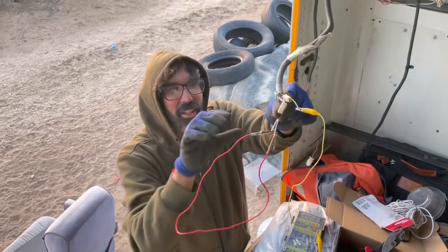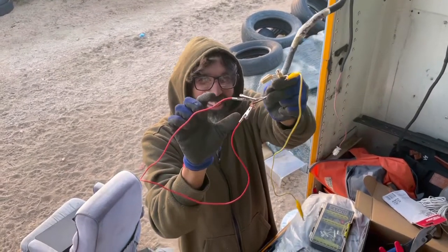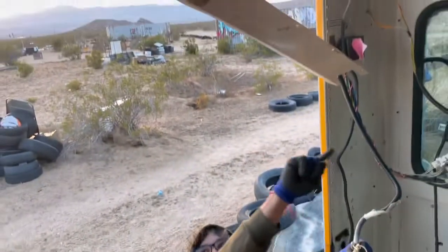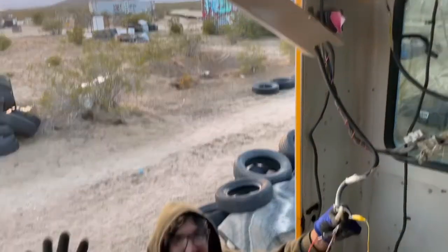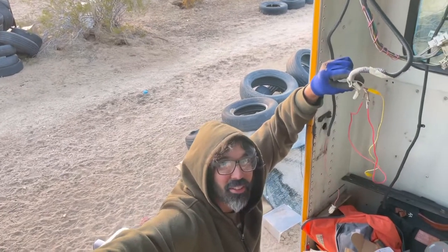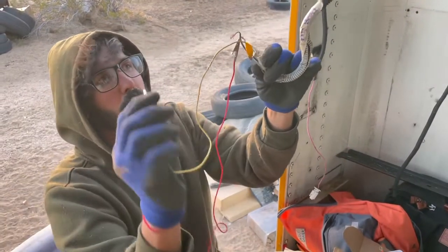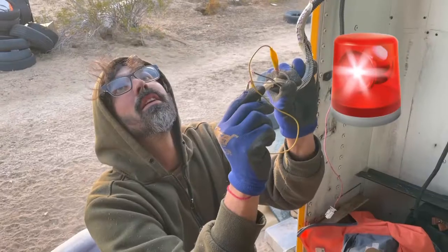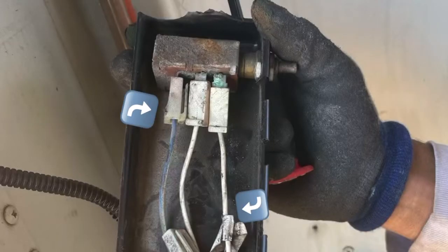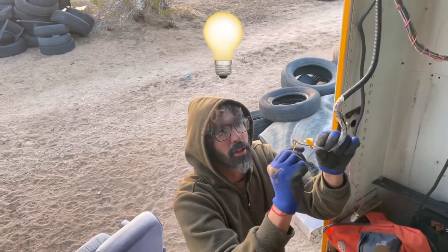We found it. We found it. These are the culprits right here — these are the two little tiny wires that are locking up the brakes. Can you believe these two rinky-dink wires? We had to put everything back together and try to rework how everything used to be back in 2011. But we finally got it. Both whites turn on the light. The blue and the white don't do anything — just the two whites. When the two whites touch, the light goes on.